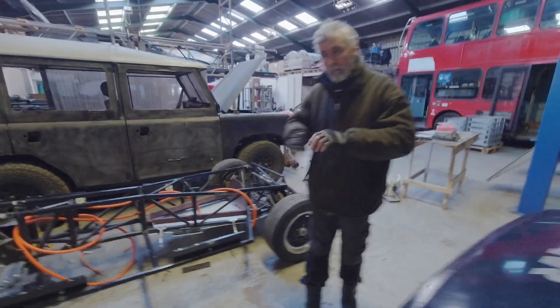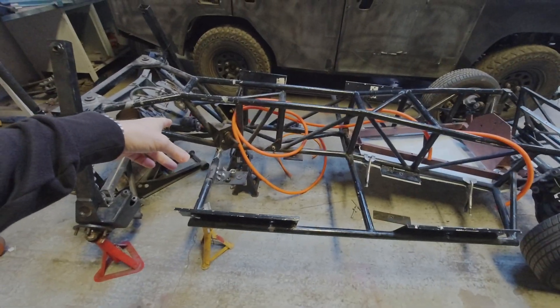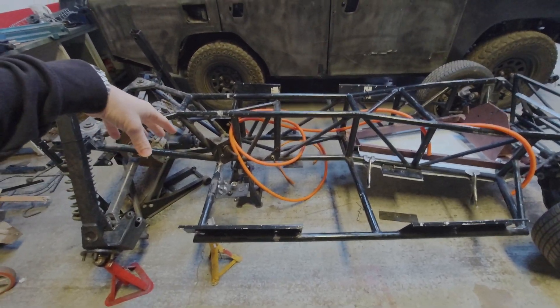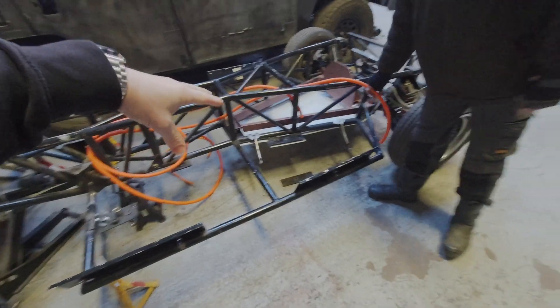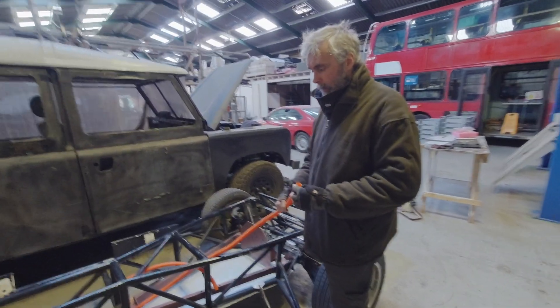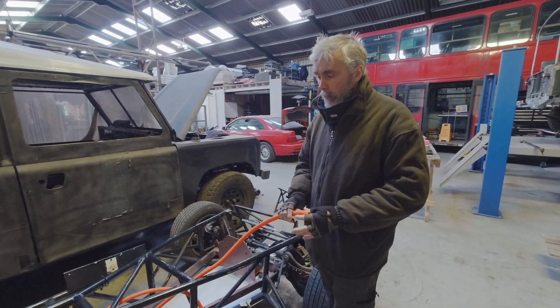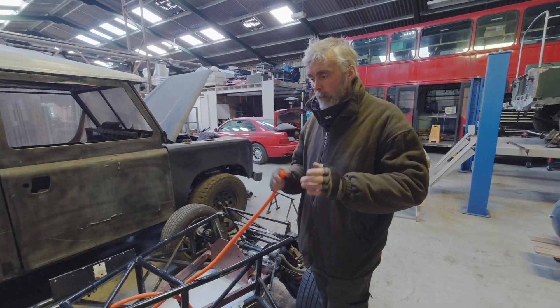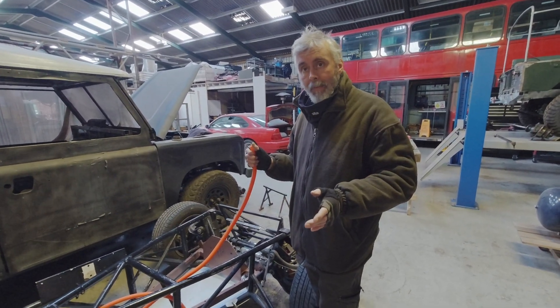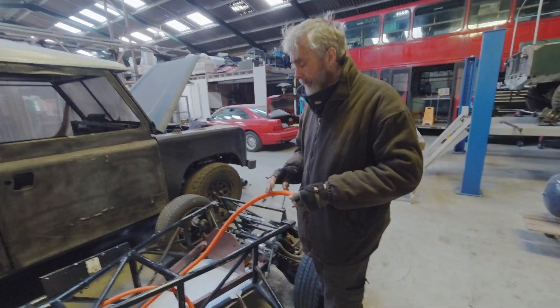You've got good shoes — yes, very durable and robust. We've got the orange HV covered — well, that's where the cables are going to go inside, isn't it — this is conduit. What we do is put conduit over the cables anyway because they're exposed to the elements. When we're making the cables up, we mock it up with the conduit first to get the right lengths, then we can make the actual cables the correct length.